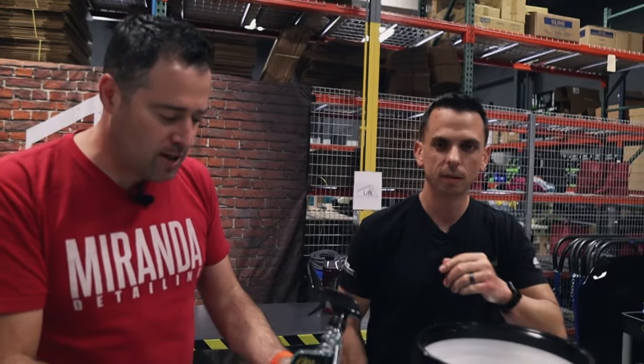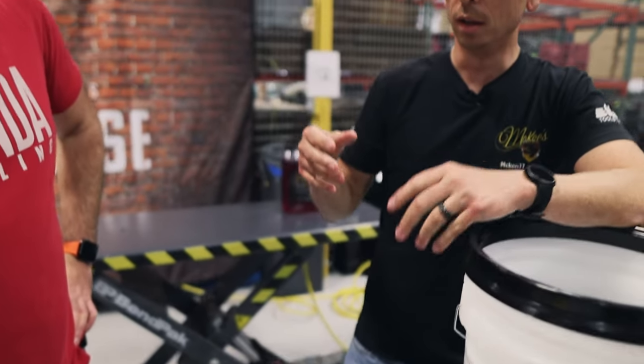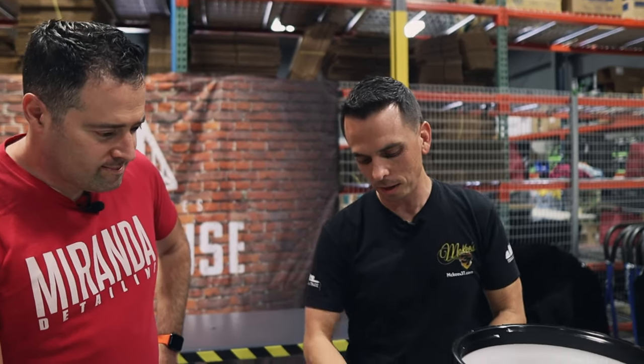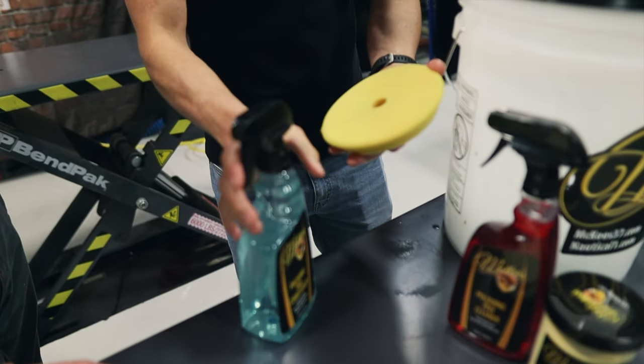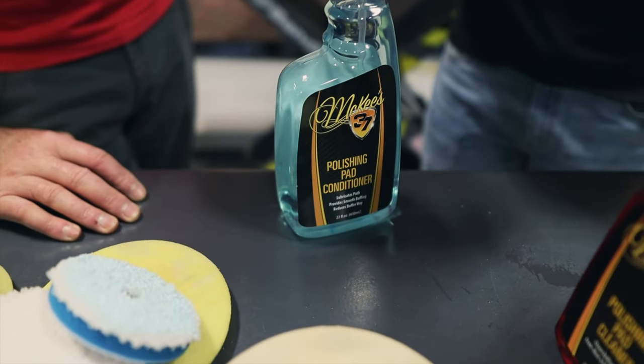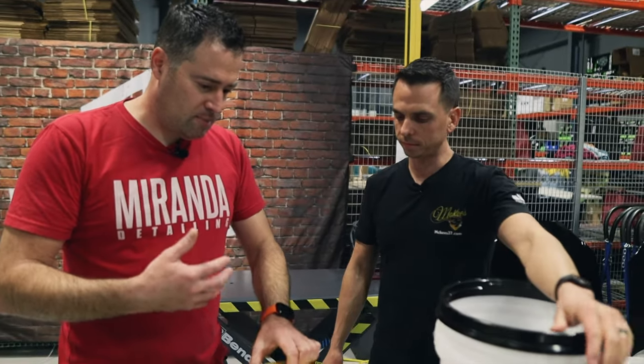Be innovative and try different methods. Down in the comments, share how you clean your pads and how you dry them. Another product here is the Polishing Pad Conditioner. The conditioner is designed for when you're working on paint that's very dry and brittle — usually single stage, something that cakes up a lot on the pad. It contains wetting agents and lubricants. Before you put your compound on, you just take this product and do a couple of mists — that's all it takes. It primes the pad and adds lubrication, so when you're working on single stage or really oxidized paint, it doesn't build up as much and it makes it much easier to clean.